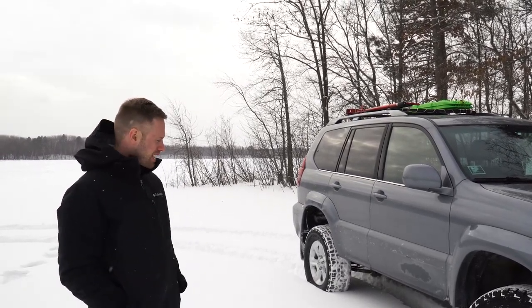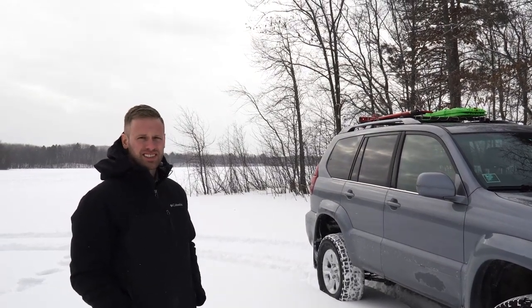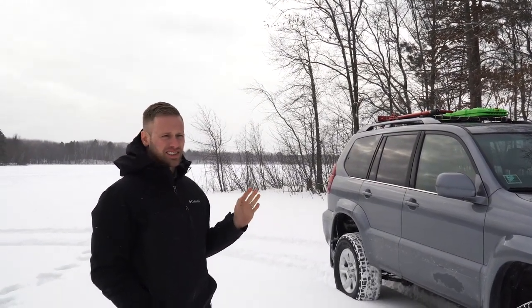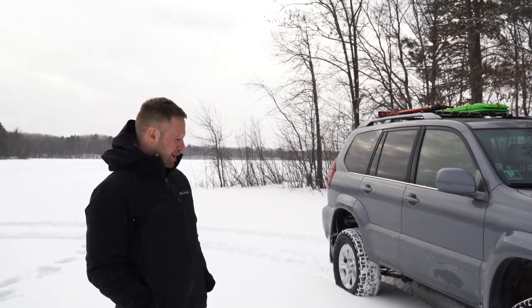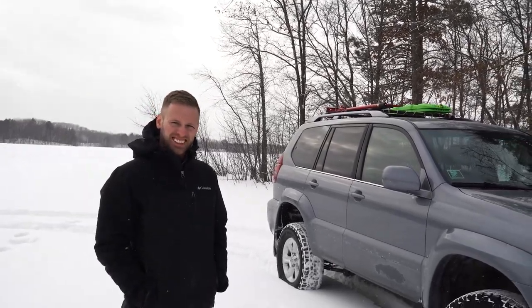So, awesome. I got those tires. They're 265/70/17s. Okay. So the stock is a 265/65/17. Okay. And then I just have them mounted on 4Runner SR5 wheels. Okay. So, yeah, I picked them up off of Craigslist for super cheap. Nice. Awesome. Well, they look brand new, so that's great.